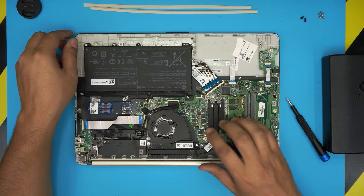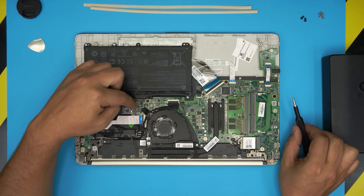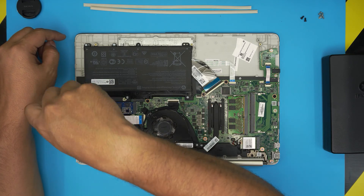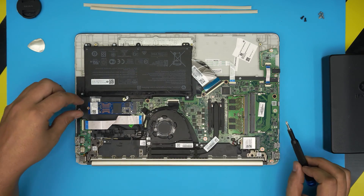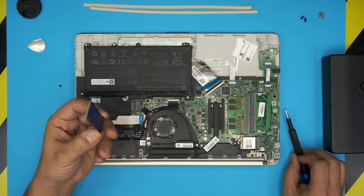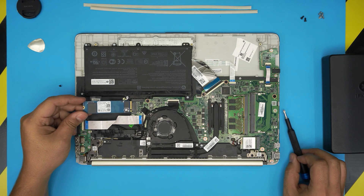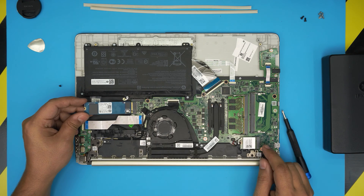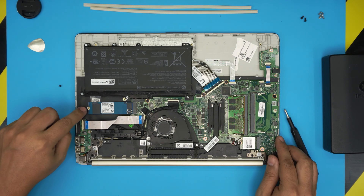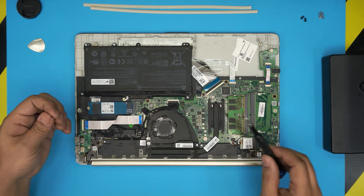The SSD that comes with the laptop is right over here — it's an M.2 NVMe PCIe NVMe drive. To remove it, there is only one screw holding it down — Phillips number one. Remove that tiny screw at the back, lift the drive up about 10 to 15 degrees, and pull it back out. When installing the new one — I have a Western Digital NVMe here — there's a notch on the connector; make sure it matches. Insert it at 10 to 15 degrees, push it all the way into the connector toward the board, and the screw hole should align nicely. Then grab the screw and screw it down on top.